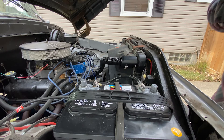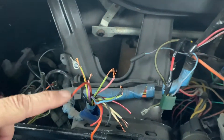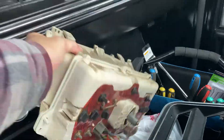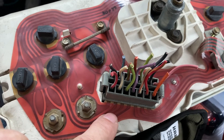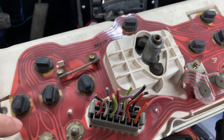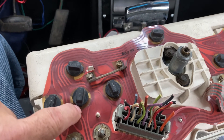This should go without saying but I'm going to say it anyway — don't do this with the battery on. We've got the dash off obviously, we've cut off the connectors. I traced the pads — yes, I traced all these circuits. So for example, if I take this red and white one here, I just follow this circuit around to tell me what's what.